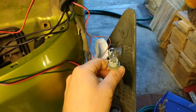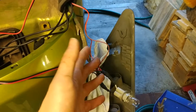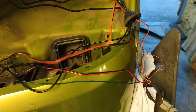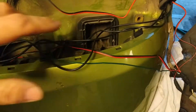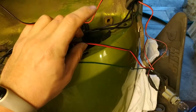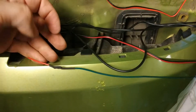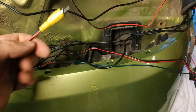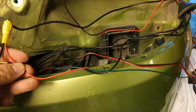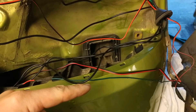The second thing is to find the reversing bulb — where your reversing light is — and find the positive and the negative of it. If you have just positive, then negative would be any ground point, you can use the car body as negative. This is where the red plug goes — it's power for your rearview camera. The green one is the one I extended, and this is the other side of that cable. You just need to connect this to the positive of your reversing light.